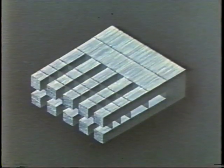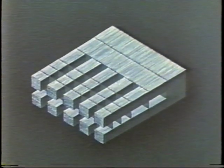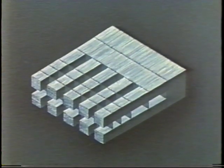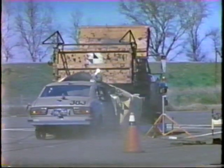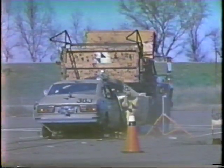In the initial design, the attenuator structure contained a series of sections, or cells, of honeycomb material. This design was developed to provide a suitable lightweight truck-mounted attenuator for both 4,500-pound and 2,200-pound vehicles. In each test, the car was self-propelled and was kept on-line with a cable guidance system and released a few feet before impact. A speed control device on the car maintained the desired impact speed.